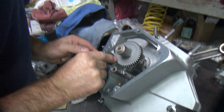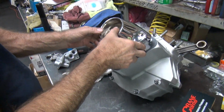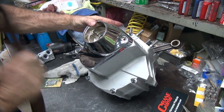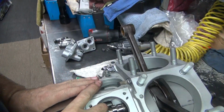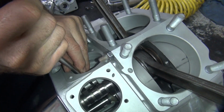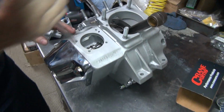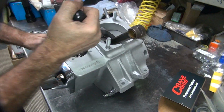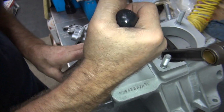So we rotate the breather valve around to where the screen's where you can get to it. Because that's the only way you can check end play, you have to slide it. Really? So I'm assuming it's probably lacking end play. Tap it together. Hey, don't mess my chrome up. Still have end play on that? Yep. It appears to be a little snug, Fred. No, it doesn't seem to be much end play on there, Tatro. I think we need to do some end play. Need to sand that little disc down a little bit, or change it out completely.